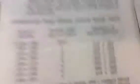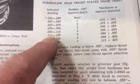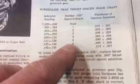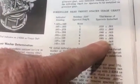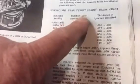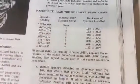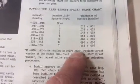If you go and look at the chart, it tells you that if your measurement is 95 to 110 — we're at about 111 — the number of spacers required: there are 16 thousandths spacers and it tells you how many are required. This one looks like it requires 5, or 80 thousandths worth of space in there. I found out that these spacers come in two different sizes compared to the book — they come in 16s and they come in 30s and 32s. So now we need to measure our spacers to get our running clearance of 25 to 45 thousandths.